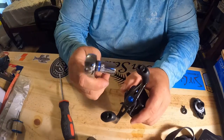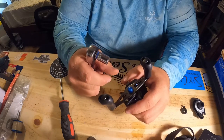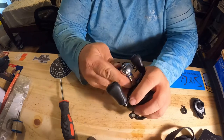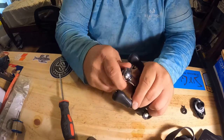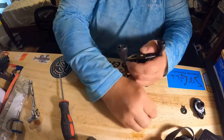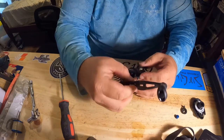Got a 10 millimeter. You can use the open end. You just gotta be careful when you put it back on and make sure you get your nut straight. And don't over tighten it because you will strip this nut out, or strip your shaft out, and then you really ain't no good. Loosen that up, pull it off, set that down, pull your handle off,